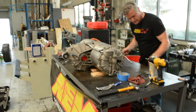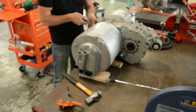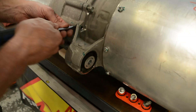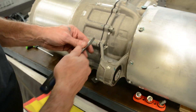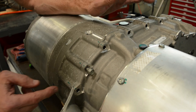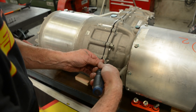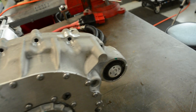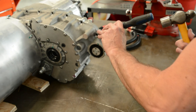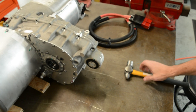The next part is I'm going to actually split the cases and get them up against the bolts I mentioned earlier that we were keeping loose. Any case you've ever split, you always find a really nice casting relief where you can leverage it apart without penetrating the machine surface. For whatever reason, Tesla decided not to leave that — maybe they thought you were never going to have to split it. There are only a couple of little areas: one right here above the rear motor mount where it's slightly proud, and a similar situation just above the motor mount on the far end. This always feels so wrong to do, but it's what works.